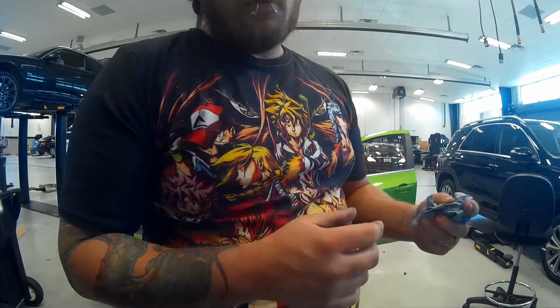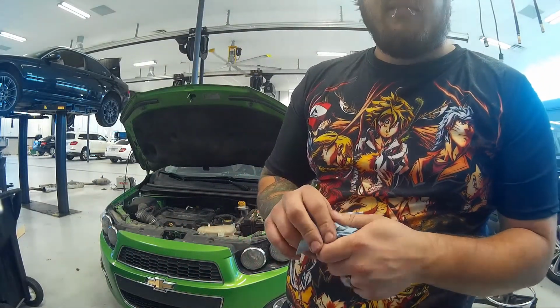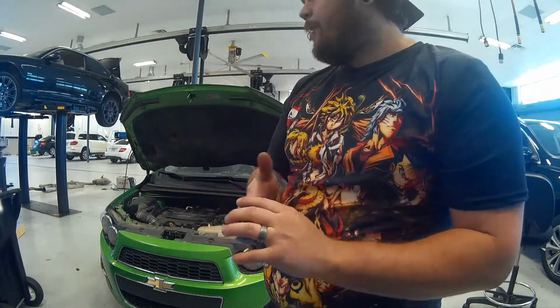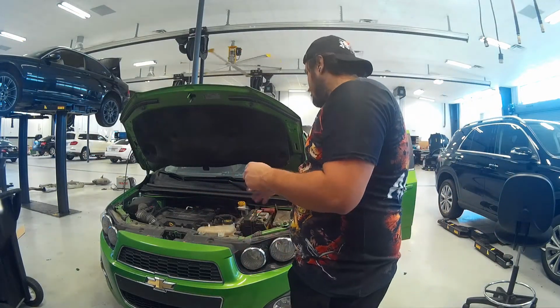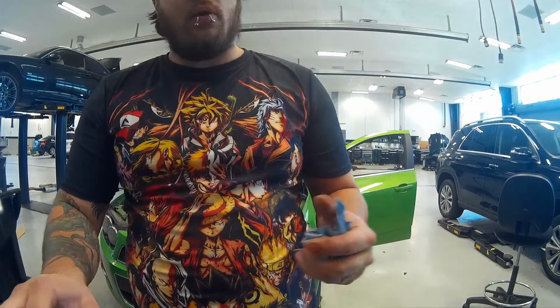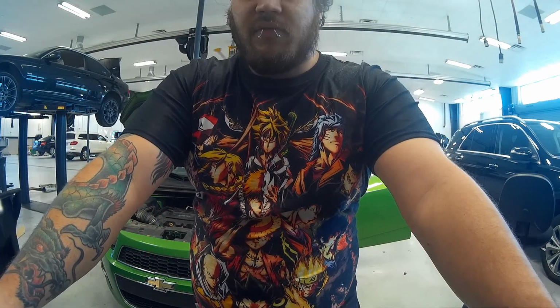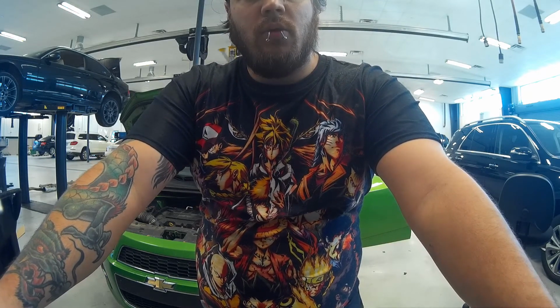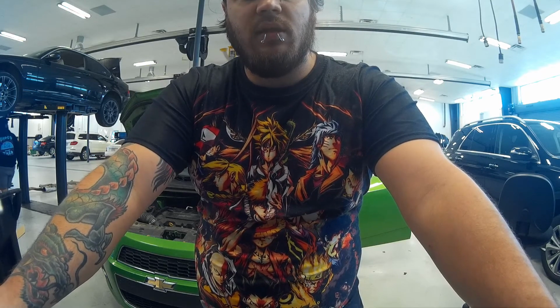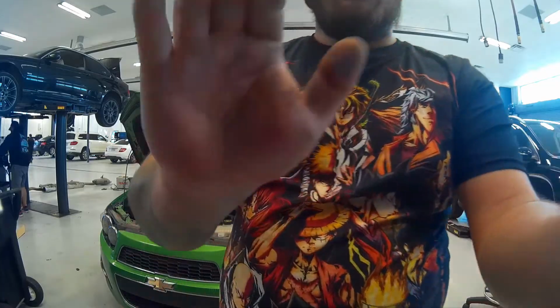So yeah, I'm going to wrap up the end of this video. The vehicle seems to be running fine. I don't feel any sort of hesitation or anything like that. Check-engine light didn't come on, so that's a good thing. It means that the coil itself is not messed up. But I will continue to monitor it and see if there are any more misfires before I call the customer and let her know that it's good to go. And of course I need to notify her about the valve cover gaskets, the oil leak on the possible lower oil pan, and the AC compressor leaking out all of its dye. So yep, until next time guys, thanks.